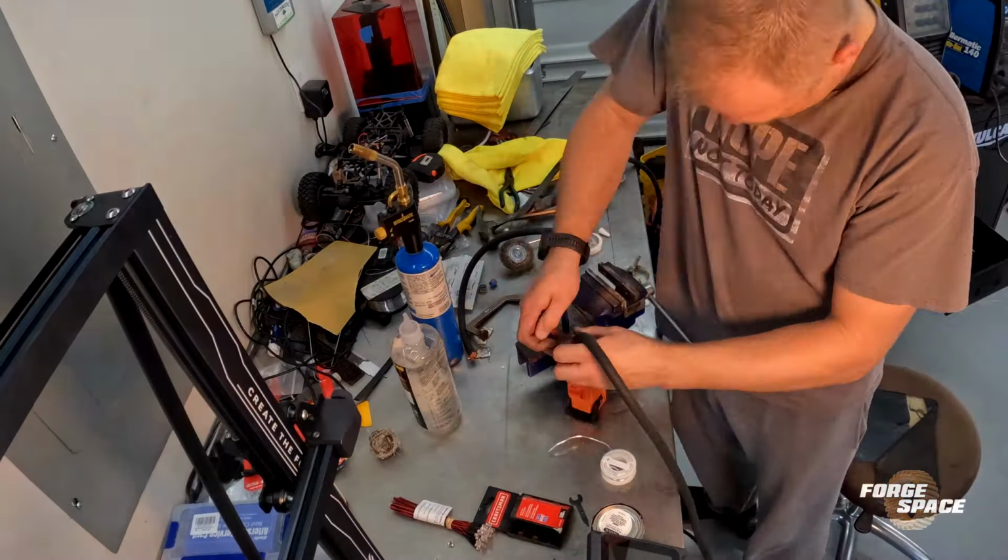So going back to here, the next two videos that I have coming up are the suspension, which is finishing up the air suspension, including the master controller, which is an Airlift Performance 3H. So it's got the pressure sensor plus the height sensors, and that way it can adjust on the fly for loads on the corners and everything else. It's a more performance-like setup.